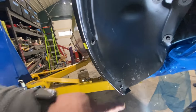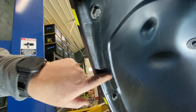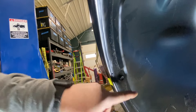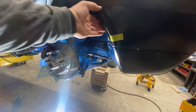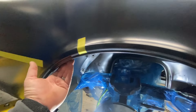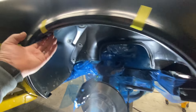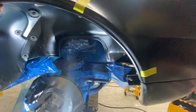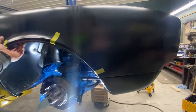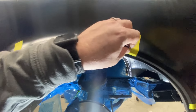On the front fenders it's pretty easy. I just gently tapped in, working it slowly, trying not to stretch anything too bad, and just worked it until it was flush with the inner fender well. Did that on both sides — slipped the wheel off, went all the way around. I marked the bolt locations because that's where it was pulled up tight and just didn't want to lose track of where I was and start beating on a bolt. I worked each section one at a time since the bolts had it pulled up tight, and it seems to have worked out pretty well.